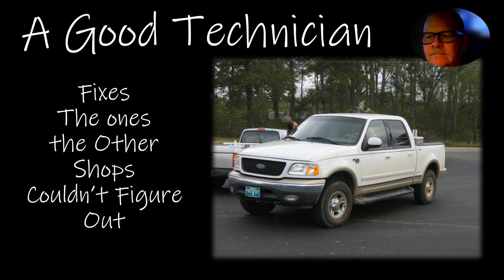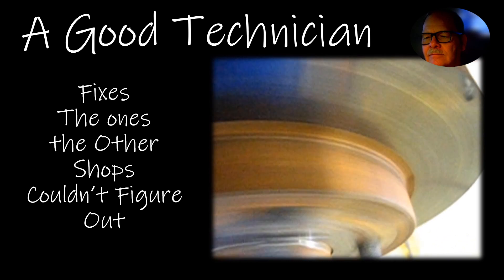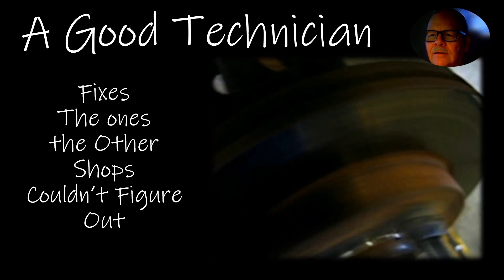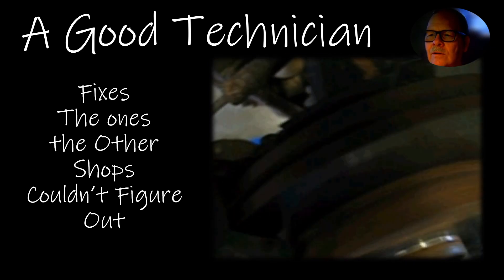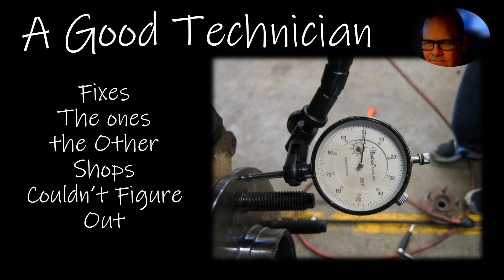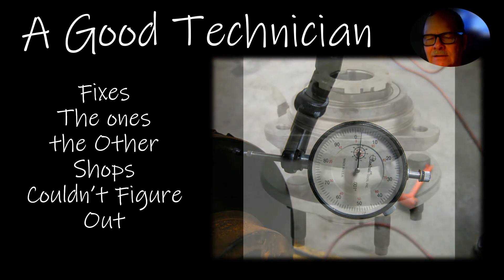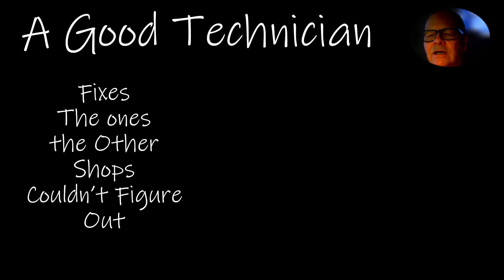This right here was doing a scrub-scrub-scrub noise. A tire shop couldn't figure it out — they machined the rotors, put new pads, but they never checked for lateral runout. That amount of lateral runout will make it go scrub-scrub-scrub. One of my students suggested putting it on the lift and in four-wheel drive. That hub had ten thousandths of runout when we pulled the rotor, which is magnified at the edge of the rotor. The new hub at $180 only had one thousandth of runout, and the rotor only had about two and a half thousandths. That completely took care of the scrub-scrub-scrub problem. You've got to think about it the right way — fix the ones other shops can't figure out.